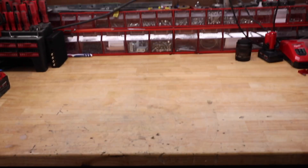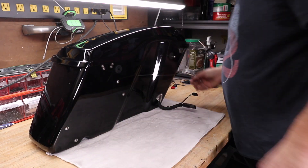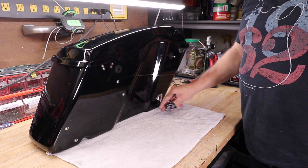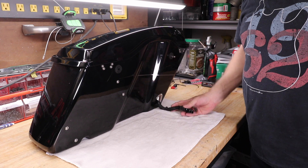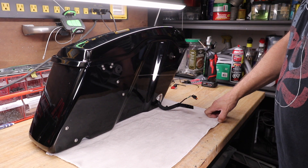Sometimes you just have to stop what you're doing and clean up the mess. Now we're onto the next phase. What I have to do is run a remote wire, which means adding a plug for the amps in the bags. The reason there isn't a remote wire already is that the amps in these bags have an auto sensing turn-on at speaker level. But now I'm running the low level RCA input, and I don't know if the auto sensing isn't in the low level circuit, or if it's just not enough juice to kick the amp on. So I have to add a remote wire — no big deal.